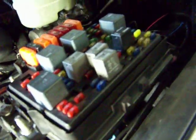A huge safety hazard. Another thing that we found looking around this vehicle was in the fuse box. Again, this is an 01-02 fuse box, so it's not compatible to this engine. What we're finding when we go through here is things like butt connectors that are not sealed. You should never use a butt connector in an engine compartment. You always want to use a crimp with heat shrink. Connectors are not plugged into anything, they're just laying here.